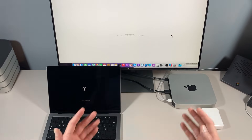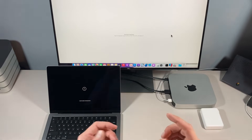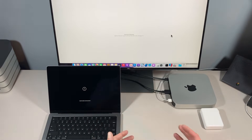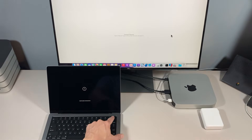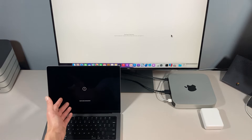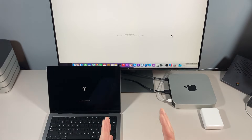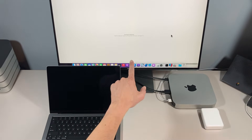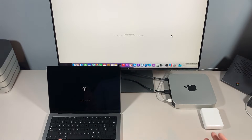DFU mode is the same as on iPhone. If you need to restore an iPhone you hold down the power button and the home button to put it into DFU mode, which allows you to restore iOS. Ever since Apple introduced M1 in 2020, all new Macs can be booted into DFU mode. If you can't boot into recovery by holding down the power button and you get an exclamation point saying there's a problem, you don't necessarily need to reinstall or erase your disk. You can just reinstall macOS recovery with Apple Configurator 2.